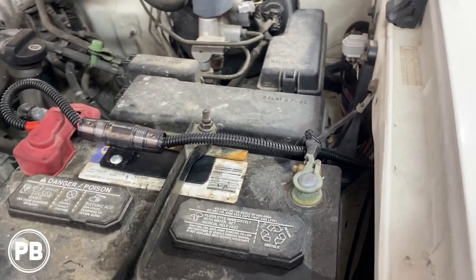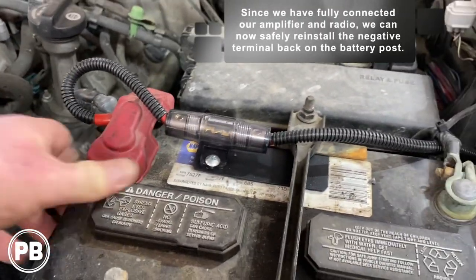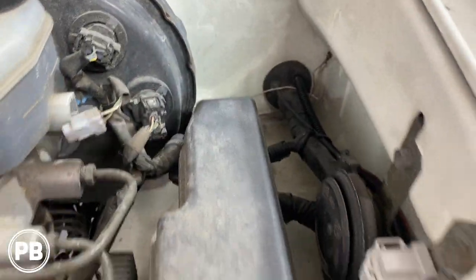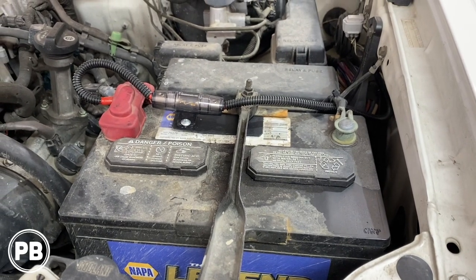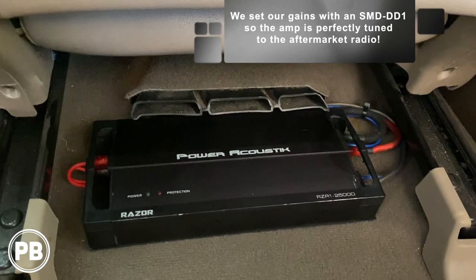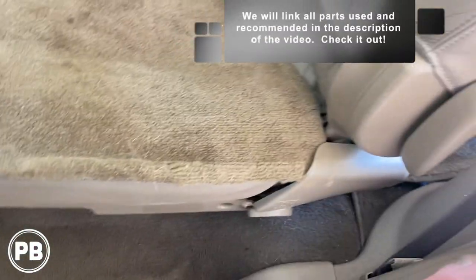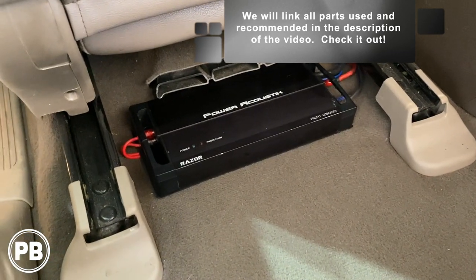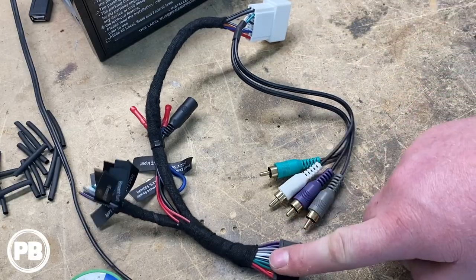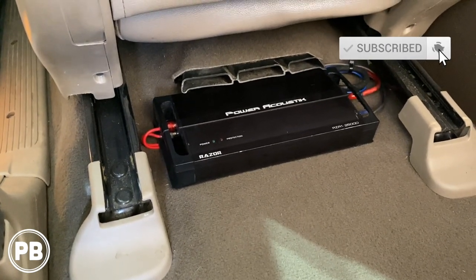We got our amplifier hooked up — power and ground connected to the amp terminals, and connected to the power post on our battery. We created a nice fuse mount and fuse holder that sandwiches up underneath the battery mount bracket, and everything is split-loomed all the way back to where it passes through the firewall. The amplifier is all seated, nicely mounted, not going anywhere — the vent will vent over the amp, no problems there. We ran our sub wire to the sub in the trunk. That's about it for this install. If you have any questions, post a comment below. Check out our video on how we installed a radio on this model year Sequoia — link in the description. Hit the like button if you liked what you saw, and don't forget to subscribe.